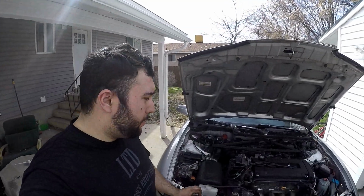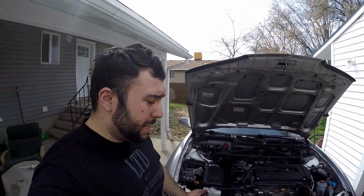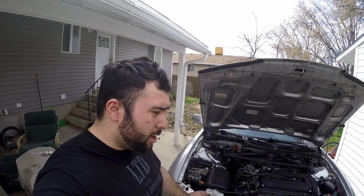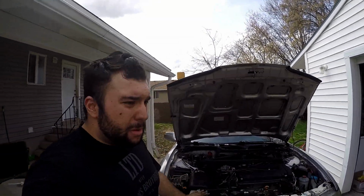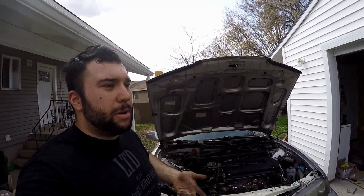I'm going to put that in with a fresh filter, and then I'm going to run it for 500 miles like that. Then I got tips of actually hammering on the car, because that compression is what seals the rings, which makes a lot of sense actually. I'm only skeptical because of the tune, but the AFRs are looking pretty good. But I'm going to drive it very easy for like the first 50 miles, make sure everything's working properly, and then I'll slowly, gradually build up into it.